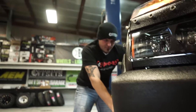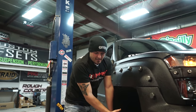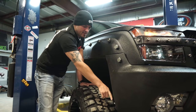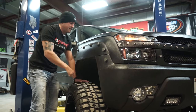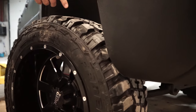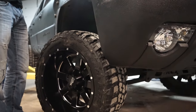But this is where it gets confusing or complicated, because this is a 12 wide negative 44 on a 33, and this is a Chevy 1500 / Avalanche 1500 — they have similar fitments. This has already been trimmed to fit before the spacer. Now we've added the spacer, and if he cranks that wheel, you're gonna see that it's gonna smash right into that front bumper. So this would need a whole new trim job because he added that spacer.